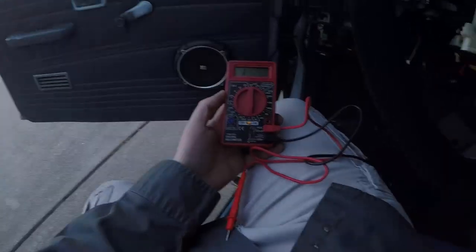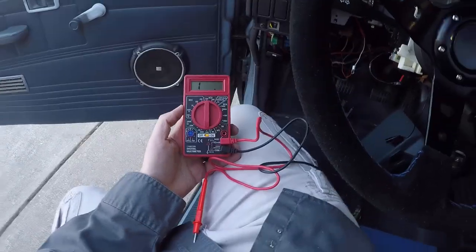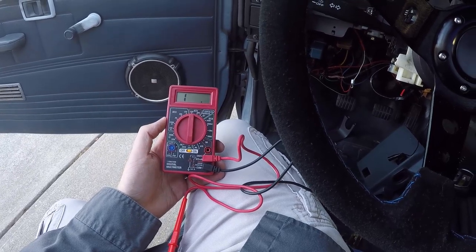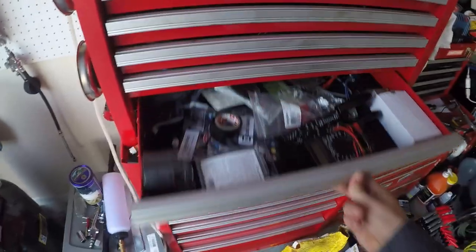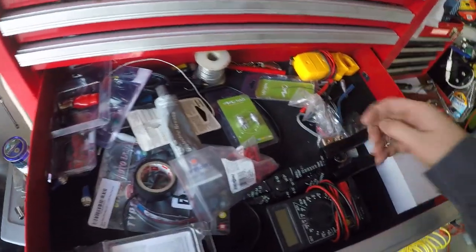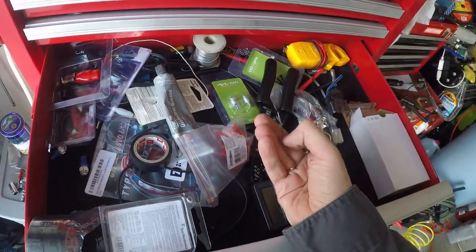This one even came with batteries — how cool is that. Either way, we've got our digital multimeter set up to measure in ohms, and probes plugged in. Testing across those leads to see what we've got. Just checked — I got nothing. I'm not sure exactly how that speed sensor works or if I should have continuity. So we're going to test individual wires. I need some back probes — safety pins, T-pins — got my back probes.